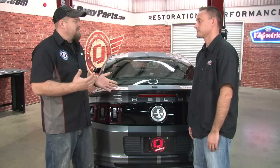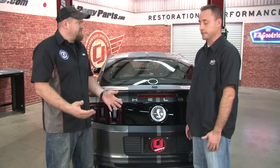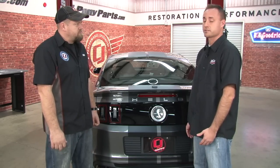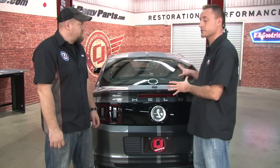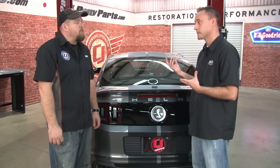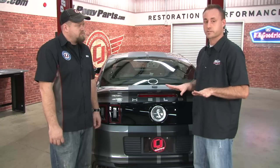What's the best way to get started? Obviously the suspension is a direct replacement for the factory pieces, but beyond that, where do we start? Normally I like to start with the tank and the compressor. You can put everything in the trunk. We're going to show you a way to hang it from the package tray, and kind of hide the compressor down in the spare tire well.